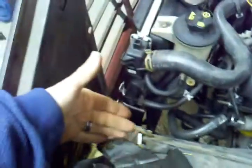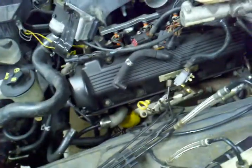This is not the prettier of the two master cylinders, but it's one I got. The only reason I wanted to go with this is because it matches the lines to my ABS. The only difference is the distance where this would mount to the frame rail down below, which is a lot greater than it is on the Crown Vic. Everything in the Crown Vic sits a lot lower, so it's not going to work that way.